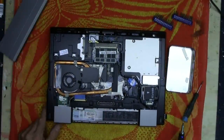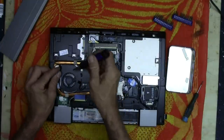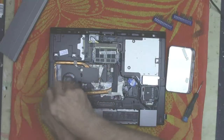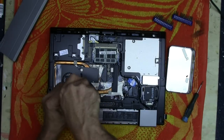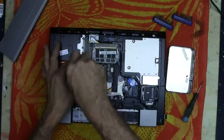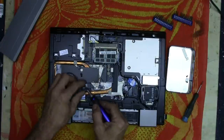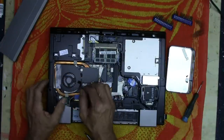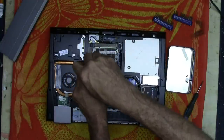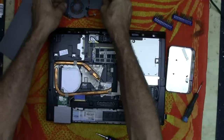We need to remove the fan first. Looks like there are three screws. Let's go ahead and take out these three screws — one, two, and three. They're all the same length. Now we've got a little plug right here — pull on it and out it comes. There's also a cover over this whole thing with a couple more screws. I should be able to lift the fan out — and indeed I can. So there we go, there's that part.